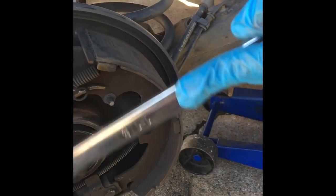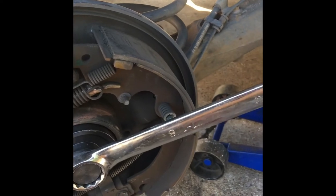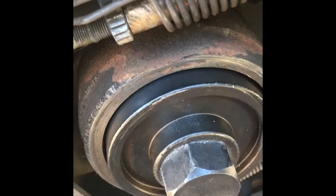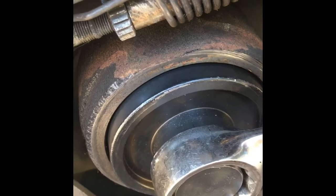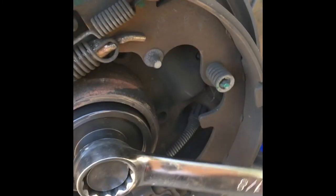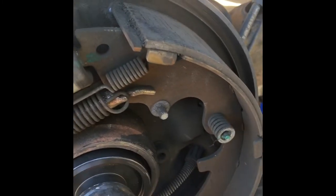Yeah, you'll know when it seats. It'll get kind of tight. When it's tight, just give it a little bit of up, and you're done. He's almost there. And that's what I mean, folks. That kit, you can't go wrong with. Look, it goes in right where it belongs, right at the very edge of the bearing and right on the inner side of this hole that they have here on your hub assembly. Oh, there it goes, that looks great.